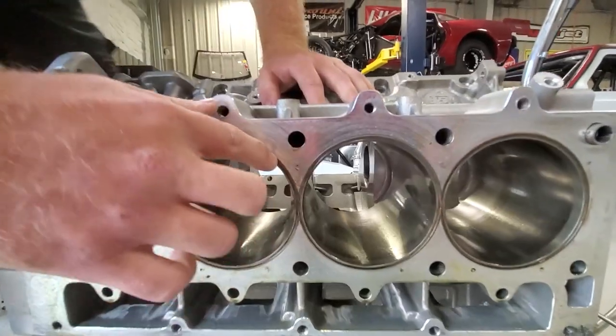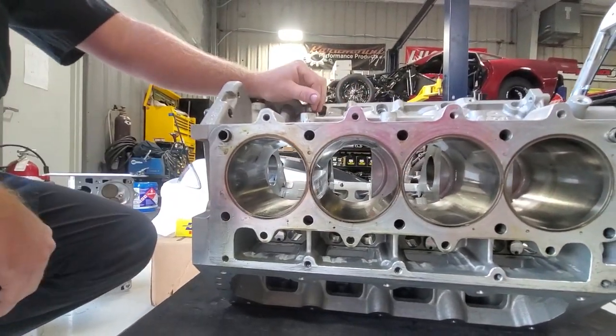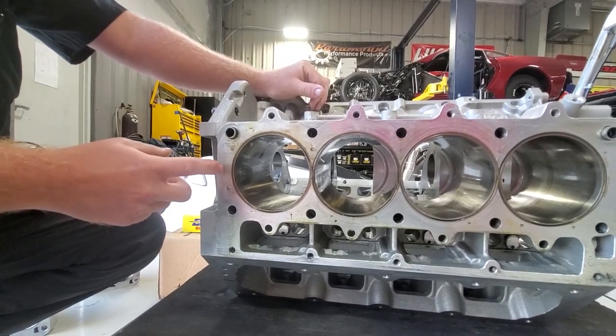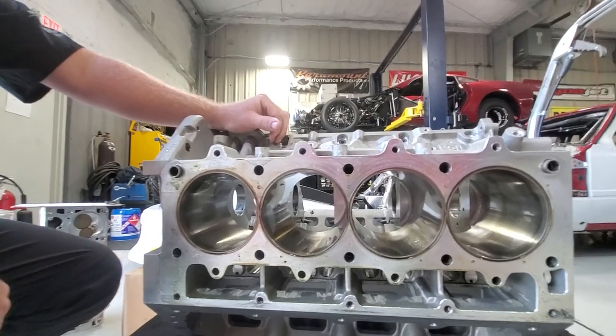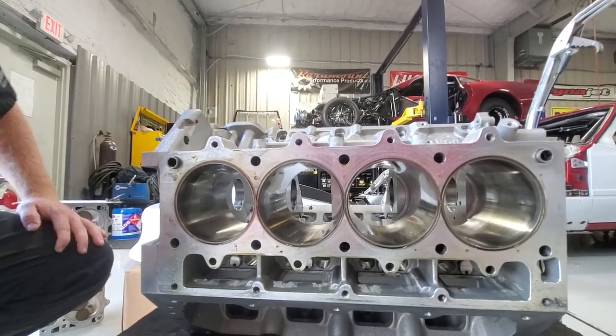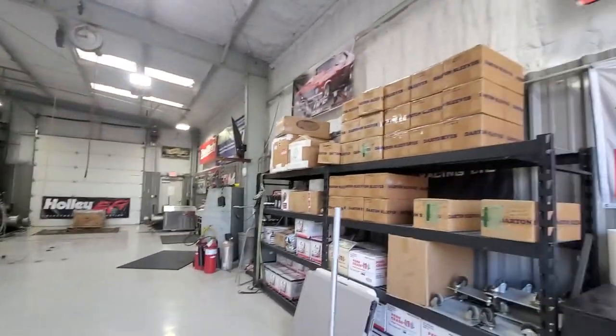And there's the receiver groove for the hoop. Oh, yeah. So it'll actually push that copper head gasket down into that hoop, or into that receiver. And that way, when you're throwing all the boost you can throw at her, it's not going to pop a head gasket. It's just that much more. Right. Just about every car we have here does it now.